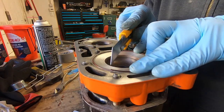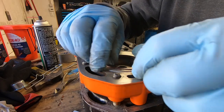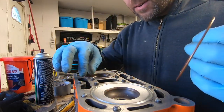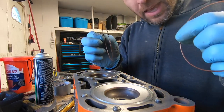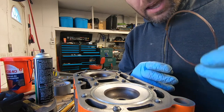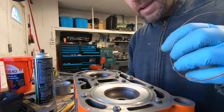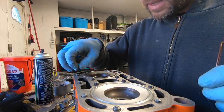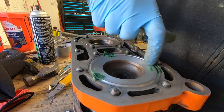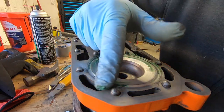I have a slight overlap there, so what I'm going to do is mark short of that overlap, take this back to the grinder and keep working my way closer and closer to fitting these together. I now have both of my copper o-rings built and I'm going to anneal them once more to make sure that they comply to the shape of the o-ring groove and squish in nice to the surface of the block when I tighten it down. I'm going to anneal these again off camera and then install them. It's actually assembly goo — I'm going to put a little bit of that in the groove to hold everything in place because assembling it without doing this would be miserable.